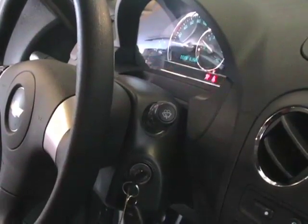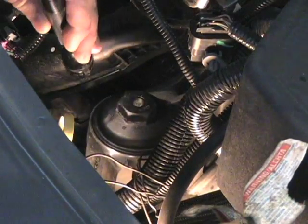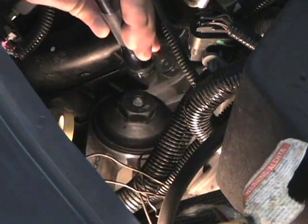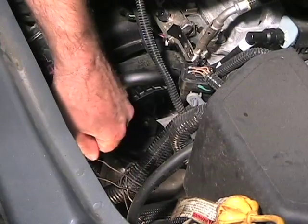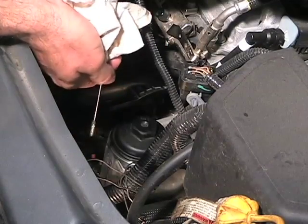Be sure to check the housing cap seal for leakage when you initially start the engine after changing the filter. And don't forget to check the oil level on the dipstick to confirm the oil is in the recommended operating range.